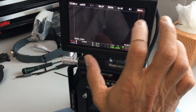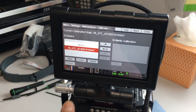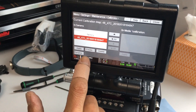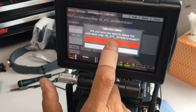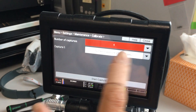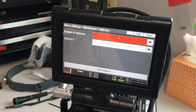After formatting the card, there you go — let's pretend we were doing sensor calibration, so we were good. We're going to go Settings, Maintenance, Calibrate, Sensor. This is the one we did a few days ago when we gave it to you, when we serviced it. So I'm going to delete that one and make a fresh one. I want a fresh calibration — Create. Just that shutter angle there — so it's factory presets, all good. But if I wanted to change the shutter or something, I would do those changes before I do my calibration. Let's say we're going to run with that. Start capture. Boom.